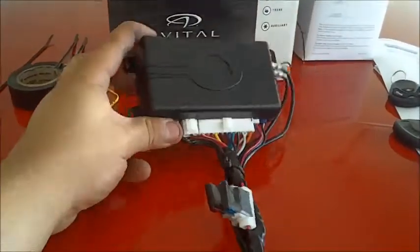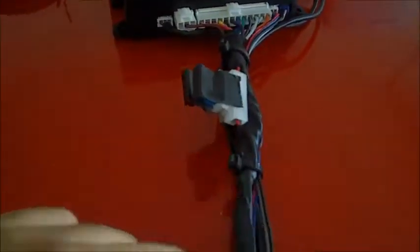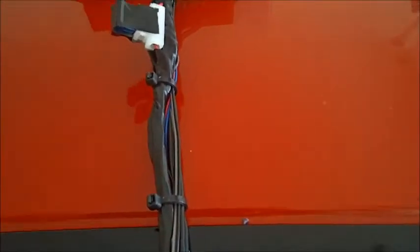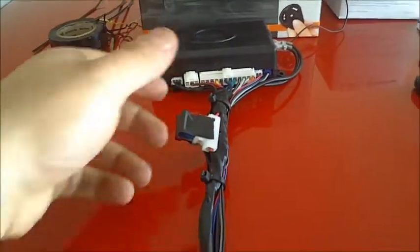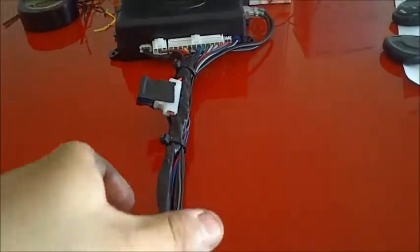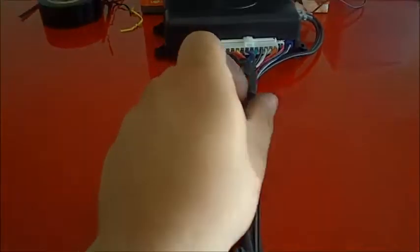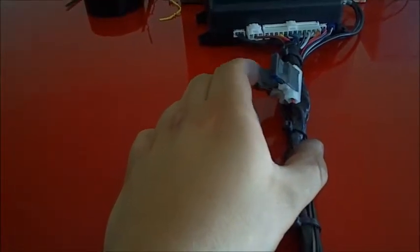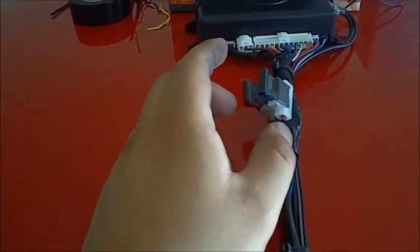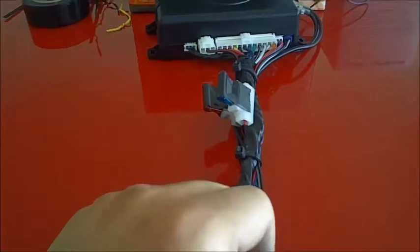Here's my prepped security system. I've taped up all the harnesses and zip-tied them all together in one nice neat loom. Some guys like to tape over them completely so you can't see any of the wires; others like to throw some loom over top. I prefer a simple zip-tie. Also, I put a little bit of tape over top because there are little parts where the metal from the fuse is exposed — in rare occasions those can arc on metal. It's very rare, but I do it as a precaution.